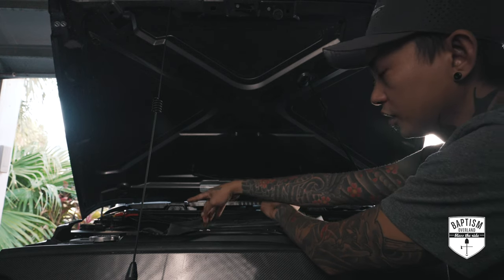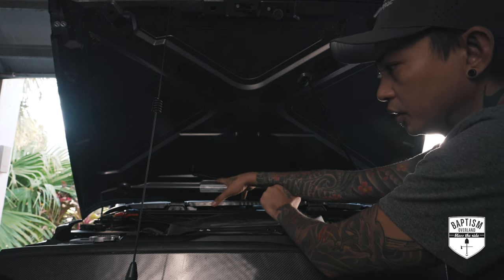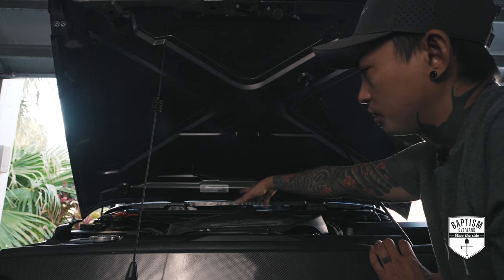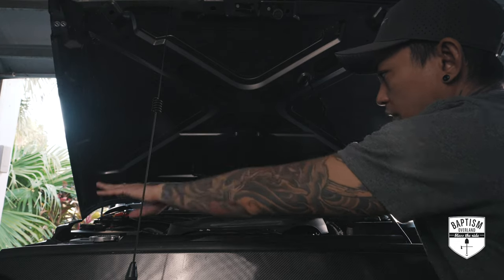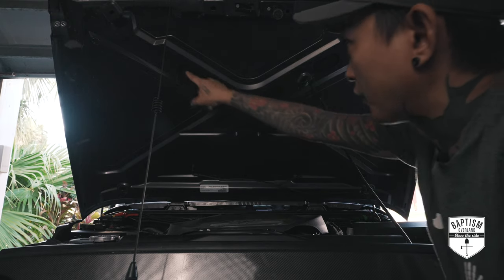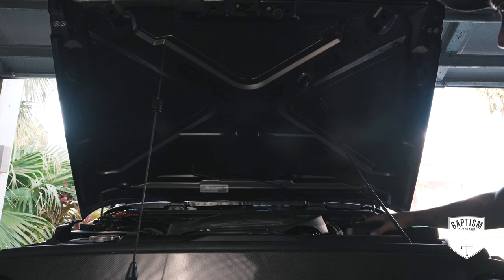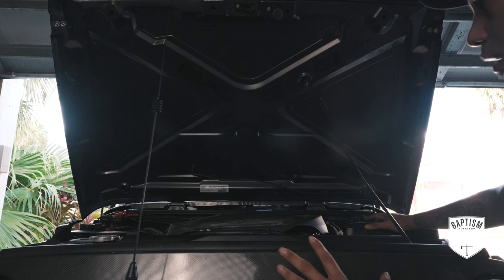Normally we check our fuses, we check our electricals, make sure all that's good and connected. And then we also check all of our fluids. Those are the areas that I really would want to see light. It's pointless to have light coming directly on top of the engine, because the fall off of the light gets weaker as it comes away from it. So I'm not gonna get a lot of light over there or over here if I put a light dead center. And if I put it up there where I've seen other people do it, it's pretty much shining down on the intake where I don't need that. And then it's gonna be shining down onto my switch pod, which is not really a necessity for me to check unless one of my auxiliary lights went out.